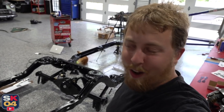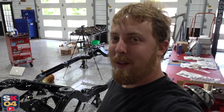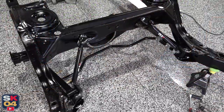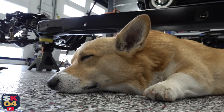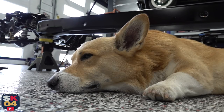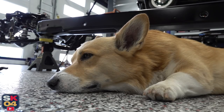I am not on my A game today. I put the lower trailing arms on backwards so the holes are too far back. The sway bar is supposed to sit just ahead of the rear end, and it's not working out. So I'm going to switch everything around and be right back. You're supposed to be my extra pair of eyes so I don't make stupid mistakes like this. Where were you on that one, boy? It's okay. Go take your night-night. Silly thing.